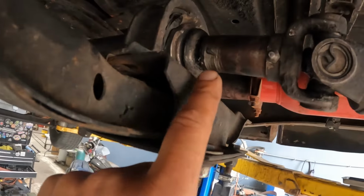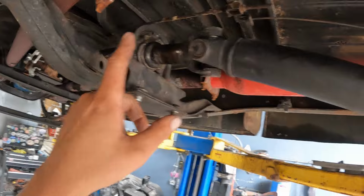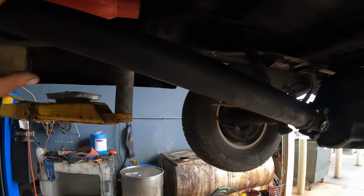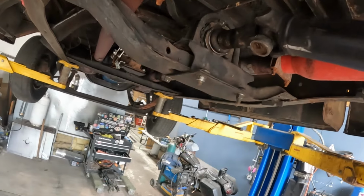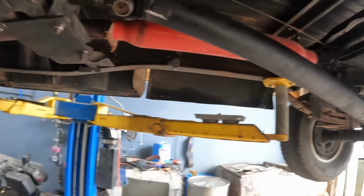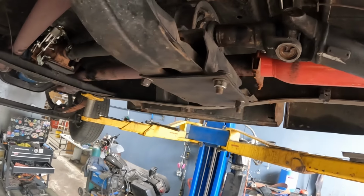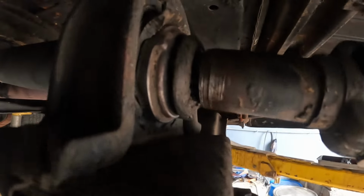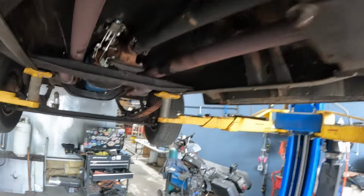with some cutting and grinding on the yoke. This was bottoming out before. That half inch length difference bit me in the behind. So this is back in now. Should be good to go on this. Spins nice and free. Don't mind the bushing that I never replaced yet up here. But I gotta put this down on the ground and double check to make sure this isn't bottoming out once we get it lower. I think that should be enough play for me. That pretty much sat on the end of the seal last time.